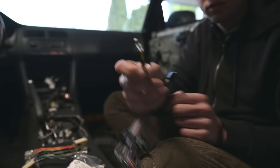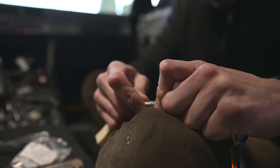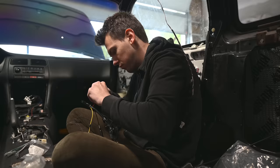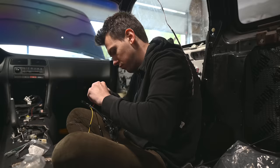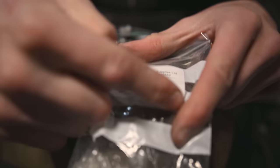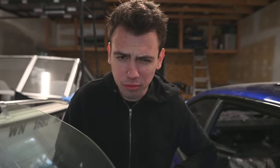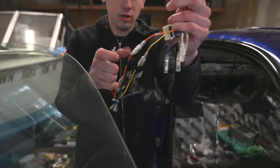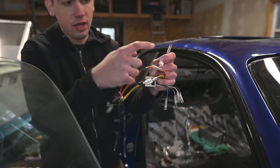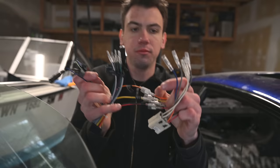This is how the male end looks like — it's got that shield on there too. On the smaller part of the shield it goes like this, and they're just gonna attach like this. That's the company I bought them from and that's the part number. I ended up adding connectors for constant power, switch power, illumination, and ground — that way if Mark ever gets gauges, I can keep adding on to them.